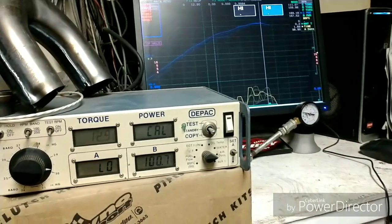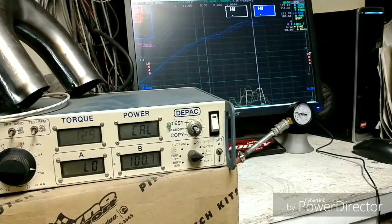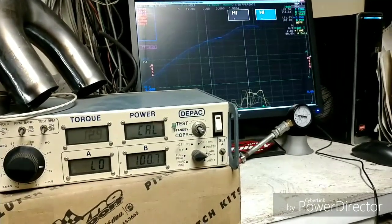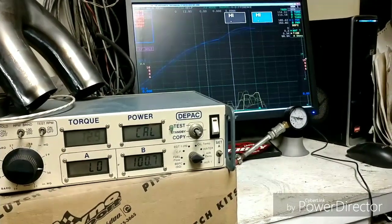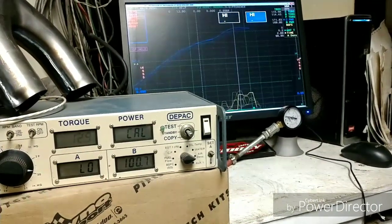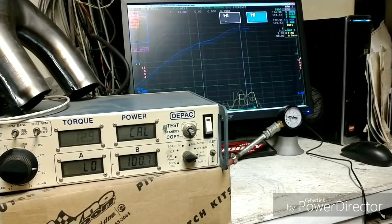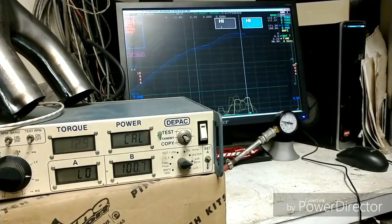There's my time graph. Then let's go down — I'm still amazed at the gain we made. There's the Y-pipe. We come up through quick. Cold pipe on the start, then we held it. So 171.63, 172.31. Peaked at 79. Tapered off at 171. Super wide band.